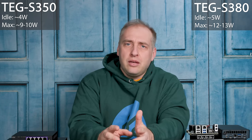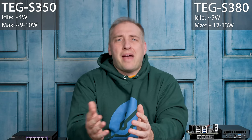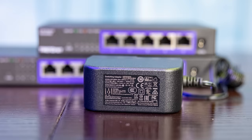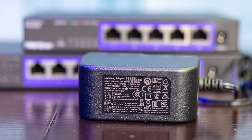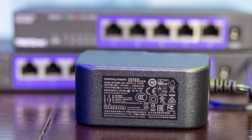After all, that's kind of the idea of an unmanaged switch. In terms of power consumption, the five port unit does use a little bit less power than the eight port unit. On the five port unit you see idle just under five watts — like four or five watts — and then maximum power consumption is somewhere in the nine to ten watt range. Whereas on the eight port unit, you're looking at about five-ish watts idle, and you can get up to about 12 to 13 watts. I think that upgrading from 1 gig Ethernet to 2.5 gig Ethernet doesn't incur a huge power penalty at these power levels, which is kind of nice.